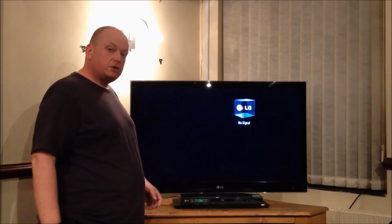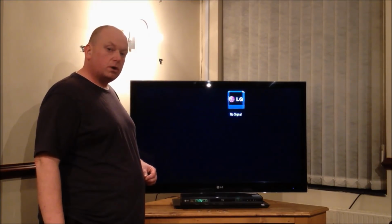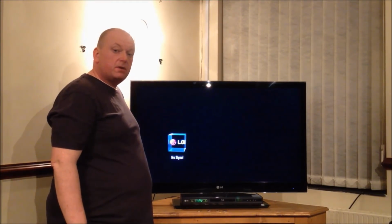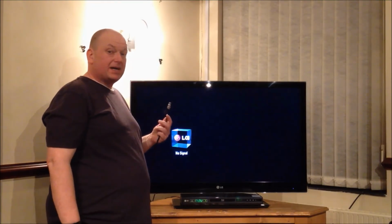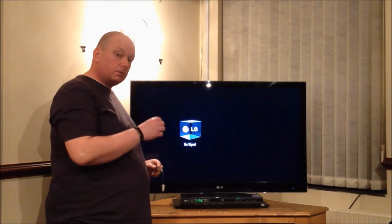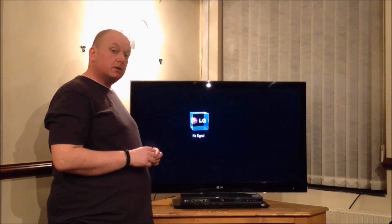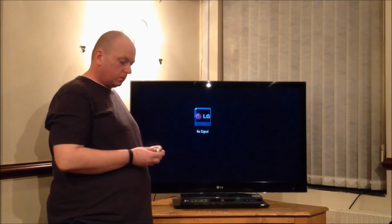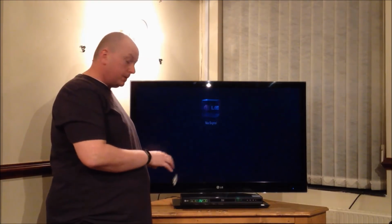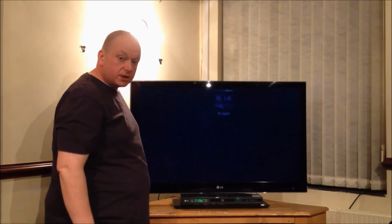But you could simply just plug it back in, couldn't you? And I'll show you now the best way to go about making it so no one can accuse you of watching live television. As many people will point out to you, there's simply nothing stopping you plugging the aerial lead back in. So what you need to do is either remove this lead, if it's like a patch lead and it plugs into your wall, or if, like my friend, you have a lead running directly from your TV aerial straight down the wall on the outside, with a hole drilled through the wall and it comes through, cut this off, remove that plug, and then coil this wire up and put some cable ties around it so it's out the way, it's looped round the back and you can clearly see that it's not in use.